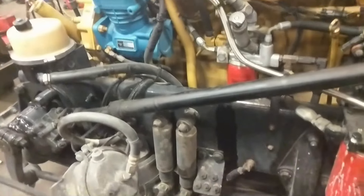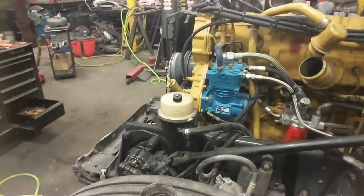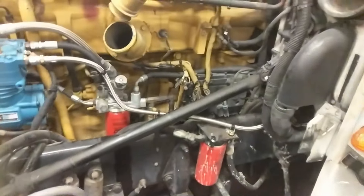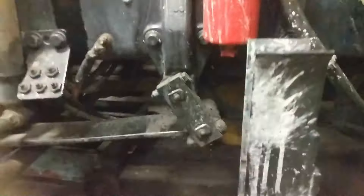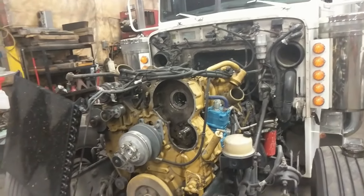On this particular engine, I think we can pretty safely say it goes back to an issue with the air ride system. He ran over some rough railroad tracks, the suspension bottomed out, and the front oil drain plug on the oil pan came down and smacked the axle and busted the pan. He lost oil.